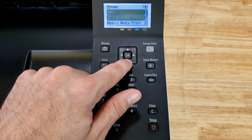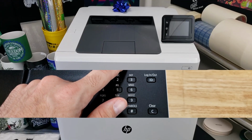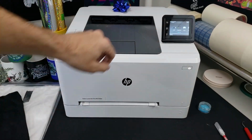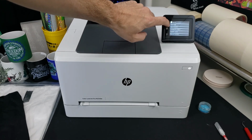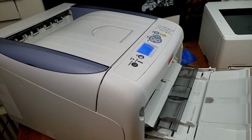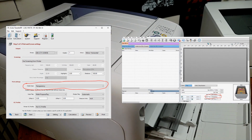The most common error that first-time users have is to not set the media settings to the correct setting, like heavy for Canon printers or color laser transparency or heavy glossy for HP printers. Even the Oki and Uninet printers will have you switch the media settings to transparency when printing on this type of media using the Forever Rip software as well as the Uninet Pro Rip software.